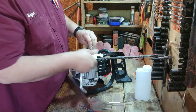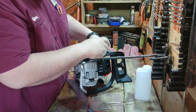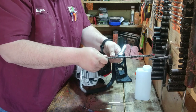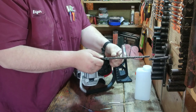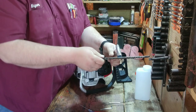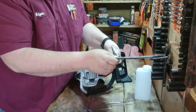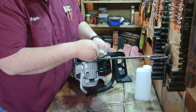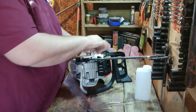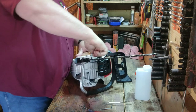We're not going to tighten them super tight yet. Now we want to tighten the bar up — the adjustment screw is on the outside of the cover, which is funky. I usually like it where I can just barely pull the teeth out. Somebody leave a comment and tell me how tight the chain should be. I'll give it just a little bit more — a new chain tends to stretch, so I'll run it a little tighter on the first go around.